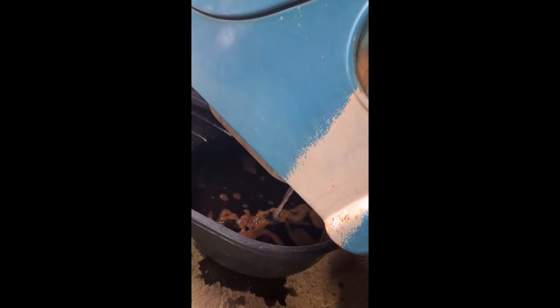We'll add the valve saver fluid into the tank. Valve saver fluid is just for cars that used to run on leaded fuel, so it's not really good to put unleaded fuel in this little thing - in 20 years I don't reckon she's had unleaded fuel in her ever. So we're going to undo the drain plug off the bottom of the little fuel tank here. The fuel actually doesn't smell too bad, surprisingly. Wow, that's a lot in there - that smells like varnish. She had a full tank of fuel in her. Well, at least we know the tank's good.